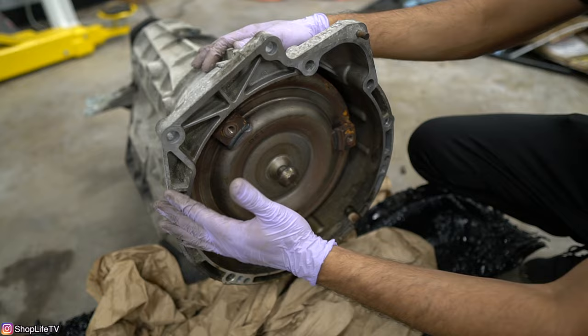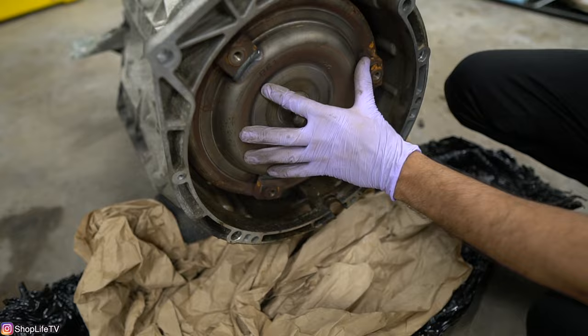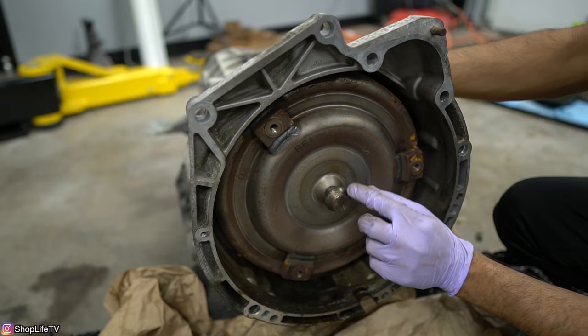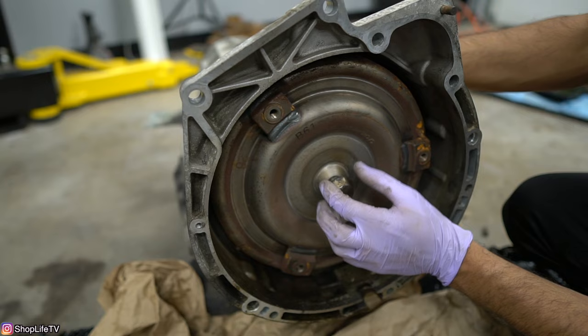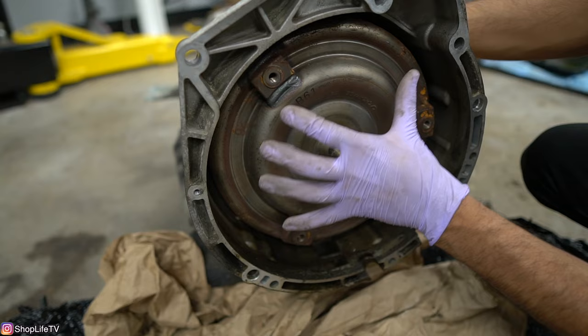With me today I've got an automatic transmission and I'm going to show you exactly what I'm talking about. This transmission came off of an E39 BMW, and this right here is the torque converter. The torque converter bolts to the flex plate on the engine. It has to slide into the transmission a certain way, which allows it to go into the crankshaft and sit in the back of it. You then bolt it through the back of the flex plate. The main issue is a lot of people don't have the torque converter pushed in all the way onto the front oil pump inside the transmission.